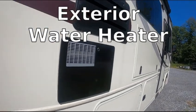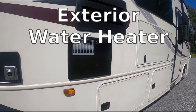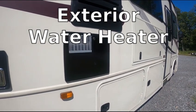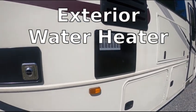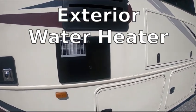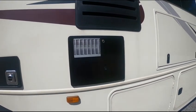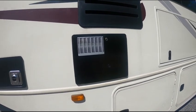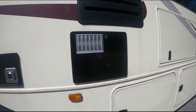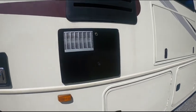You're going to hear this fun noise here. That is actually the hot water heater. I'm providing hot water in the hot water tank. So propane is now heating up that water. The hot water tank runs off propane and or electric. So if you're at a campsite with electric, just go ahead and hit the electric heater, and it's got both on there. So the gas will give you fast recovery if you're taking a shower or whatever, whereas the electric kind of keeps it warm all the time.